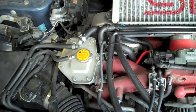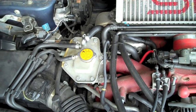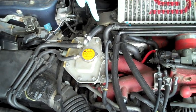With that removed, we're going to locate the lines on the other side: that's going to be on the wastegate of the turbo right there, and on the compressor housing nipple right there. There's a little vac line that runs to each. As you can see, there's a T in the middle of it as well — and that's where it's connected. Now we're moving to the front, and there's the compressor housing nipple.